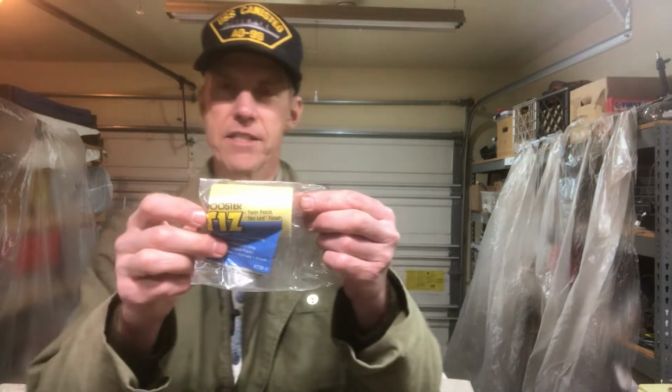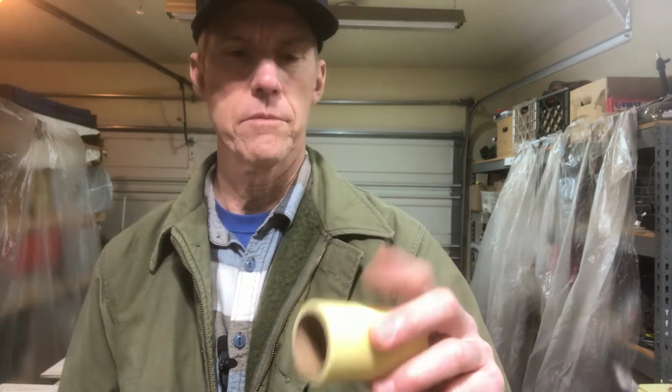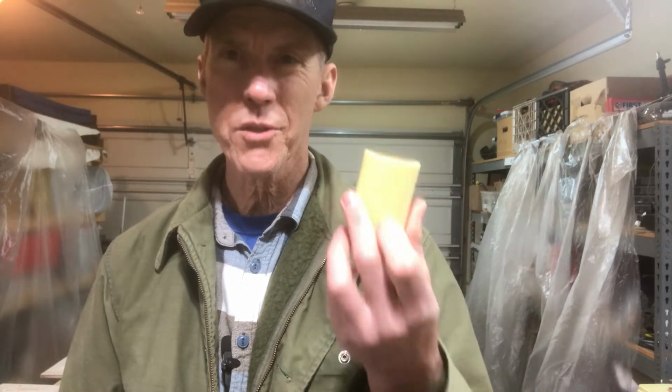And so what I found, and I've said this before, I keep trying other rollers, but what I have here is a 1/8 inch nap foam roller. It's just a sleeve with a little bit of foam rubber, right? Yeah, like padding. This works great. It works for epoxy, it works for that really thick primer I'm using, and it works for really thin paint. I mean, too bad they're so hard to get. I think I'm going to put a link in the description of where I got these, because I love them.